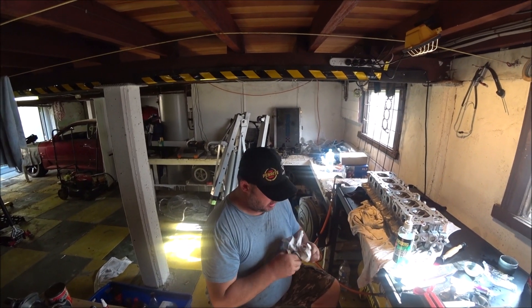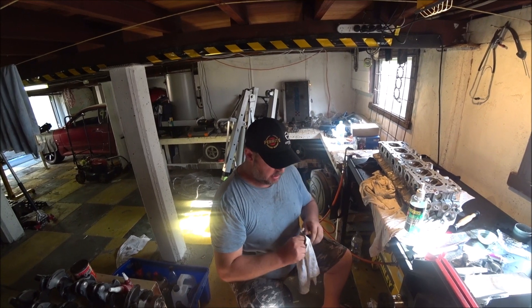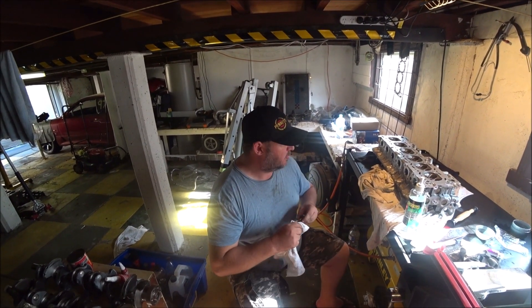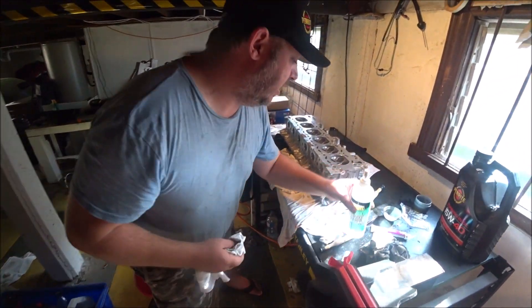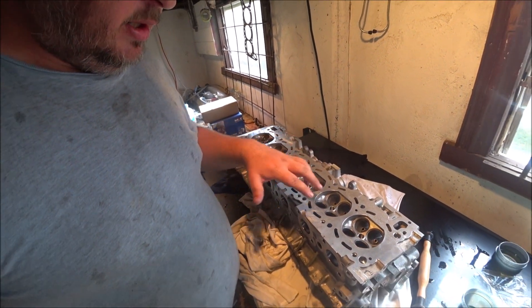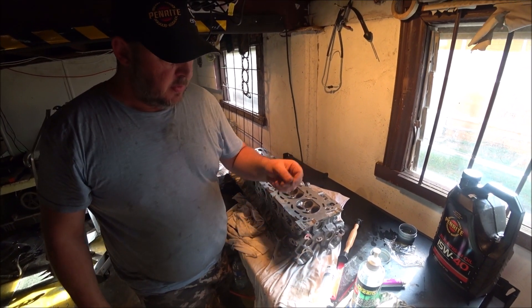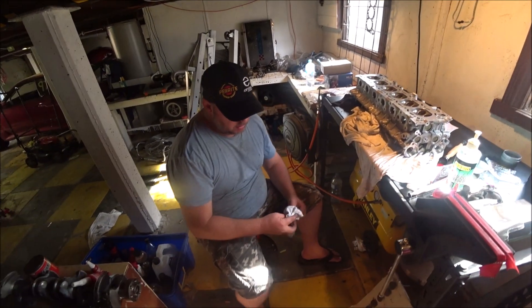Morning YouTube and the Internets. Right now I'm just cleaning up these valves the very last time before they go into the head. I've lapped all the valve seats - that's all done. I've given it a bit of a clean out and got rid of all of the valve grinding paste so that's not going to get pulled into anything important.